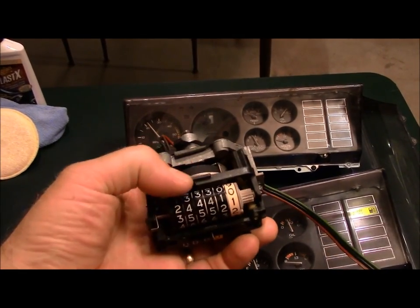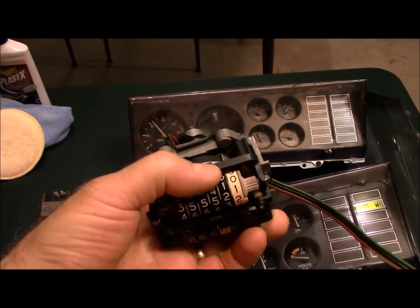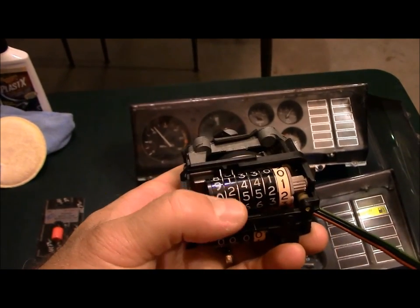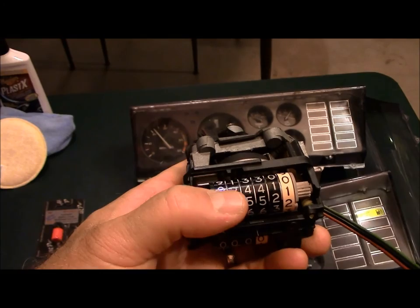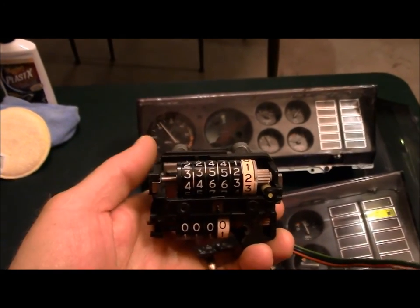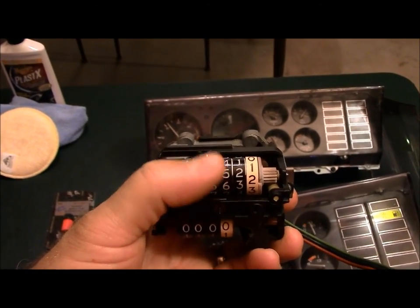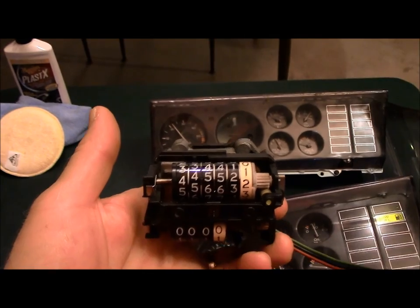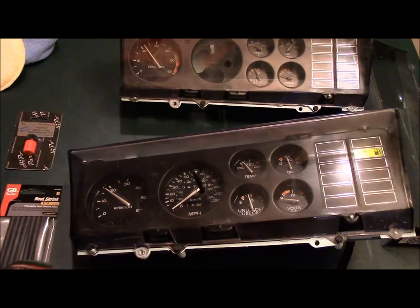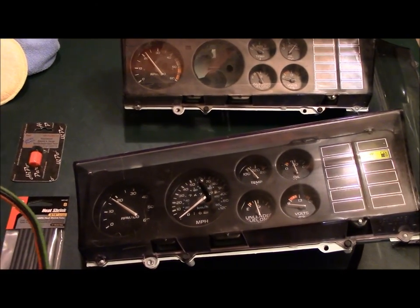It may be a bit difficult. There's a plastic piece back there — a small film of plastic that holds these tangs in place — and it is wickedly brittle. As soon as I took this out the whole thing came apart and now I can't get it to stay in place because that piece broke. So I'm a little nervous to do it to the real one, because I have no idea where to get replacement parts for internal speedo stuff like that.